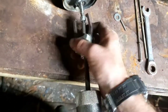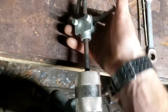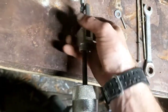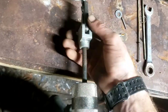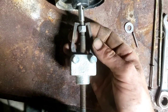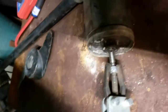Make sure this is far enough back. You get your two things that are going to hook on that nut. Once they hook on that nut, you'll tighten it all up. Then you're going to smack this thing until the whole center rotor comes out. Now you can see that's hooked on there, and once I tighten this up, I've got it all tightened up.